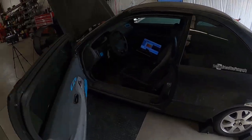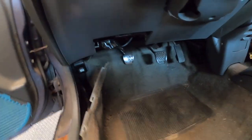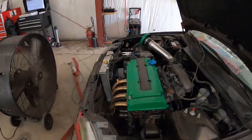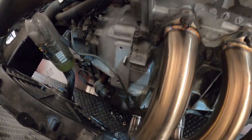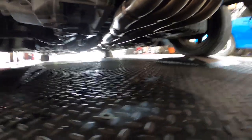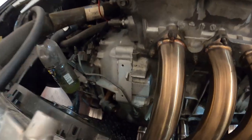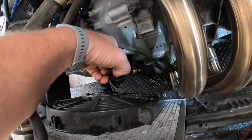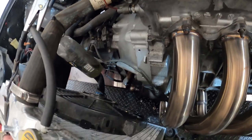Air fuels and everything seem good, but we got an issue. When I let out and threw it in neutral, it sounded like it never came out of gear. Our clutch pedal is stuck to the floor — I think we've had a bit of a failure. Yeah, we just lost everything. We've lost the bolt out of the clutch slave cylinder and she's cocked up at an angle. The clutch slave piston has shot out of it and we've lost fluid.